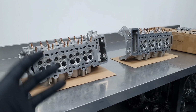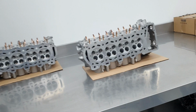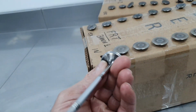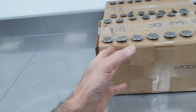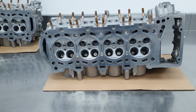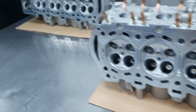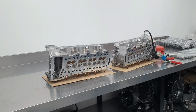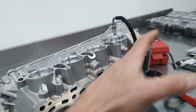So anything else? No. Stop talking. Let's grab the valves. That's it. By lapping the valves. Ready, prepared, lapped, nice. It remains the final wash, one final checkup, and then when I put it together, I'm gonna make a leak test to make sure that it's not leaking. They're looking good. Tomorrow the rest, not today. What I was saying, tomorrow the rest. I mount the valves, I make also a leak test.